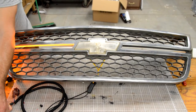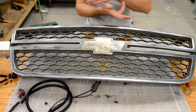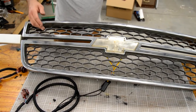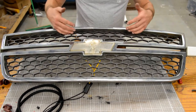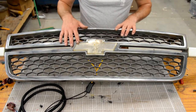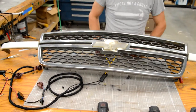If you hit your right turn signal and the left one comes on or vice versa, just take the bar off and flip it over — you can check that before you install it too. That's pretty much it: plug everything in, test it, then put the grill back on so you're not doubling your efforts if you need to make an adjustment. If you've got any questions, hit us up at sparksmith.com or look for us on the web. Thanks.